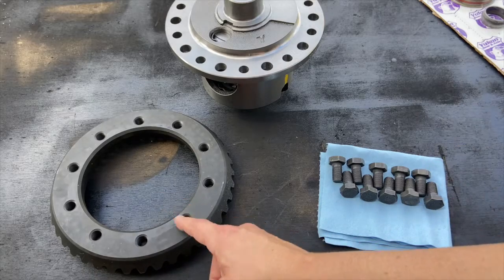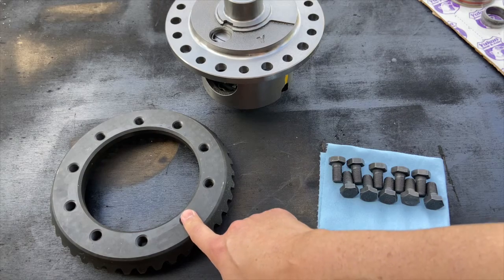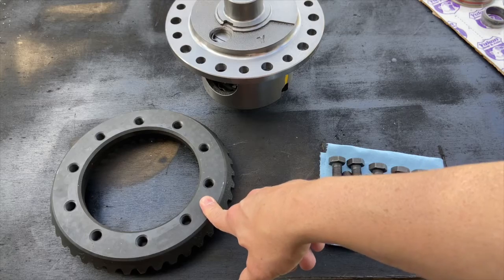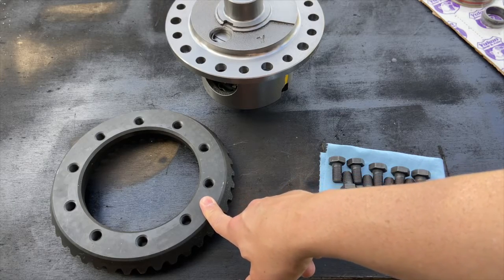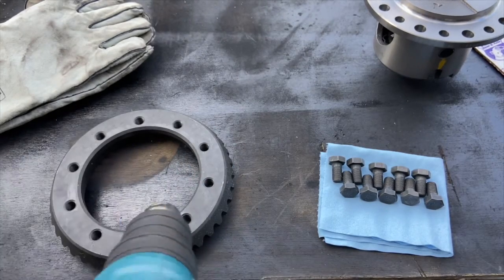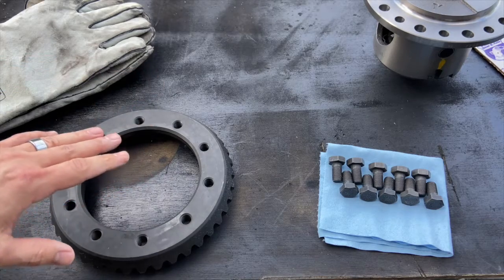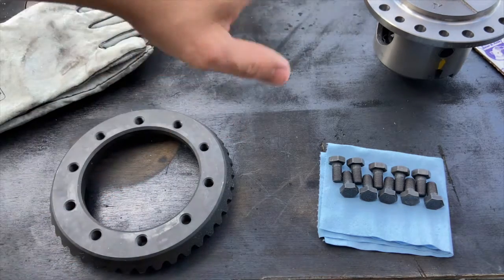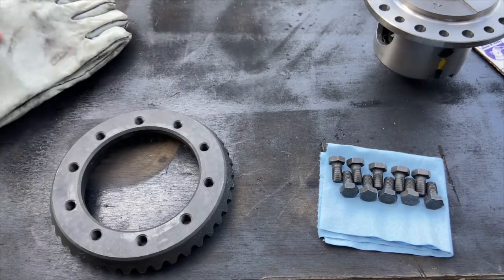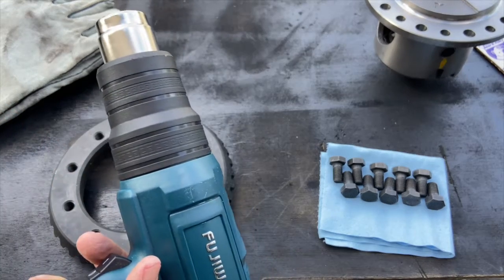The first thing I've got to do is get this ring gear heated up so it will actually fit over the carrier unit. For that I'm going to use a heat gun — some people put it in their oven, but whatever chemicals are in this thing I do not want off-gassing into my oven. This is going to be a somewhat non-scientific process; I'll heat it up slowly, test fit it, heat it up slowly, test fit it. Make sure you have some welding gloves handy because this thing is going to get hot. I'm going to put the heat gun on the low setting and begin warming it up.